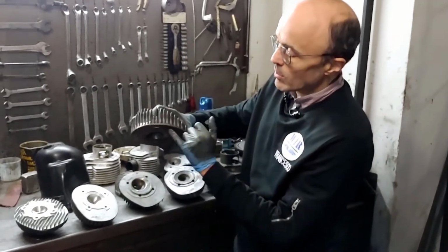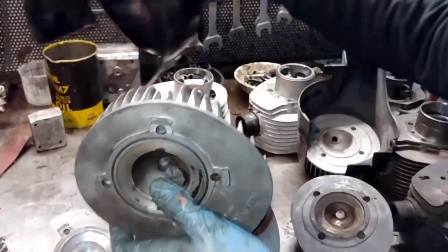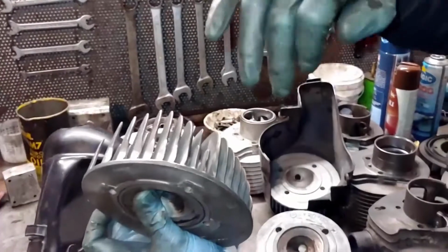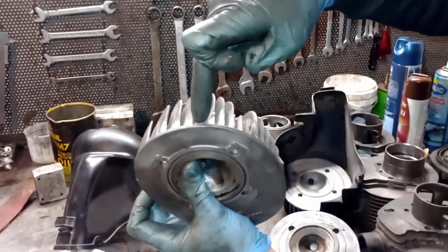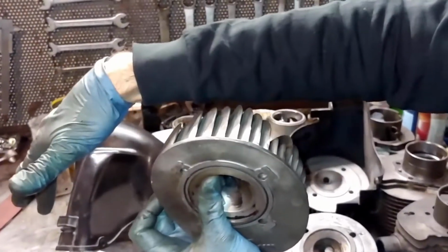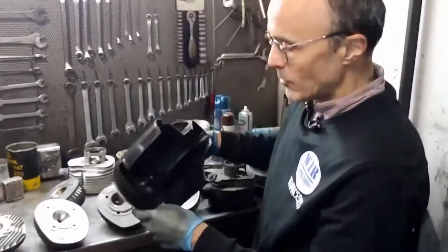You have to do the job starting from the center. You can take as a reference to start the work the hole of the stud that's located in correspondence more or less to the center of the channel from which the air arrives. From this center, more and more material is removed gradually, and then up to the third or fourth fin, and then less until you get to the second last. The last one is absolutely not to be touched, and a little to the second last, so as not to create short circuits, because if the air comes out without having done its job, it will not have removed the heat, and then we will have lost part of the cooling power we have, which is very precious, by the way.